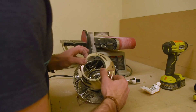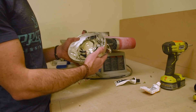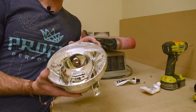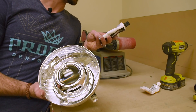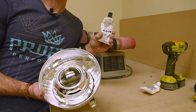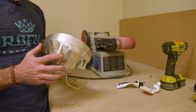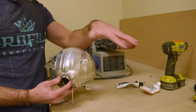The shroud is fitted on there and looks good. If this was a permanent retrofit, all this stuff would be perfectly clean. Give the JB Weld a set amount of time to cure before putting everything back together — follow the directions, it's roughly 10 to 15 minutes. Let the JB Weld cure, make sure there's no outgassing, and then go ahead and reassemble the headlight: put the reflector back into the bucket.